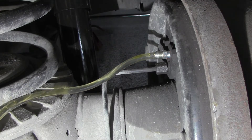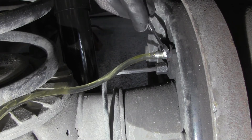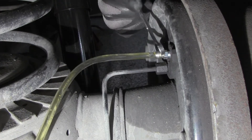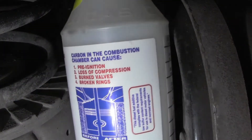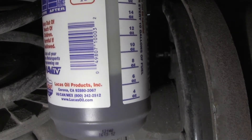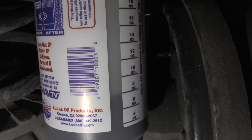When you're satisfied that the new fluid is coming out, just snug up that fitting — doesn't have to be tight. That's all we need. Now we'll go to the left rear wheel. This is about how much we got out of there. I like this particular bottle because it also measures it — there's about eight ounces of fluid right there.